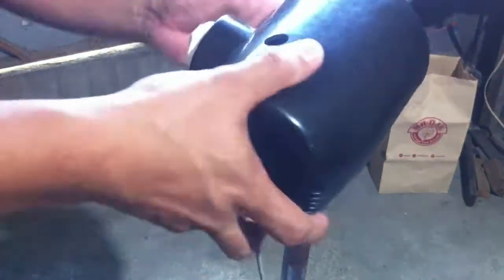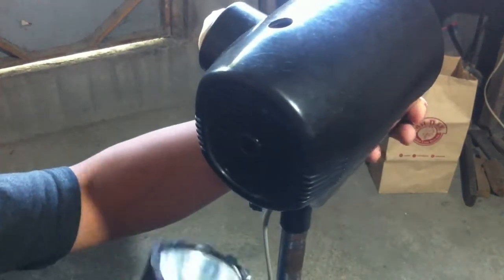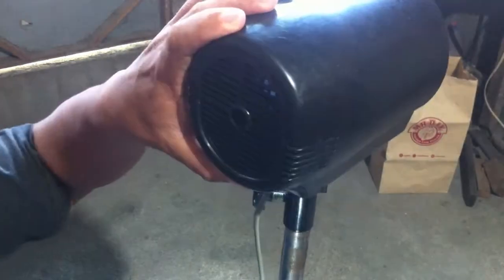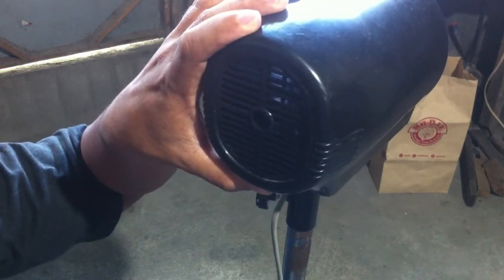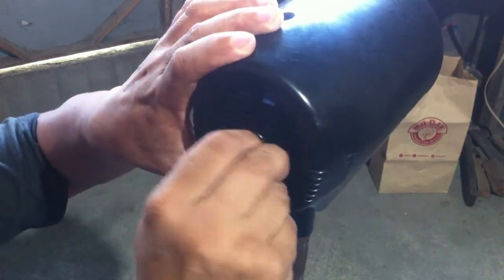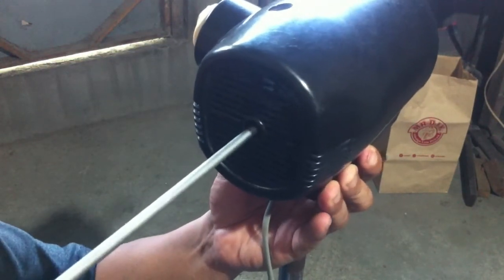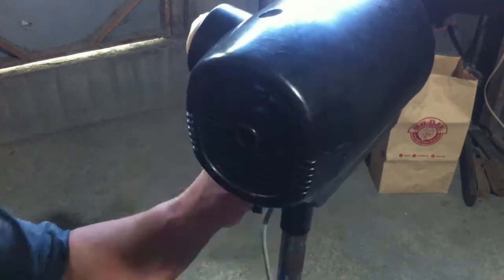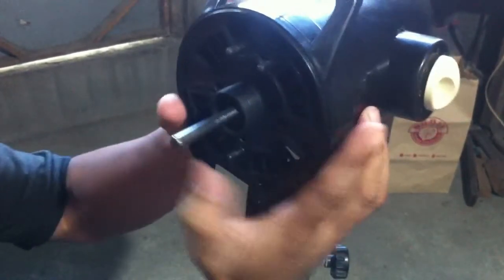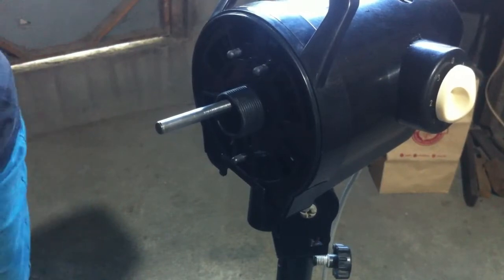To install the back cover, you need to position its hole directly in front of the screw hole of the back motor casing by using a flashlight. Hold that position and drive the screw. Make sure you have a magnetic screwdriver, or in this case I use a masking tape. I am now reinstalling the front cover, back grille, fan blade, and front grille, then the final test.